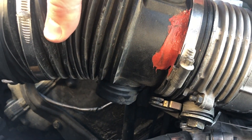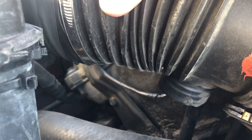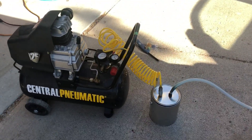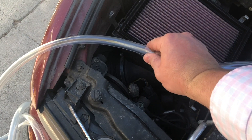This is exactly what I needed to know. There is a small cut — looks like a small cut right there in this hose, in this intake boot. And then something is supposed to connect into there — you can still see the smoke coming out. I don't know if something got disconnected, or if there was supposed to be a plug in there that didn't get connected when it got detached. I'm going to do some digging, probably not in these clothes, but there you have it — a $15 DIY smoker rig to check for intake leaks.